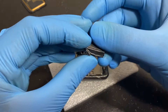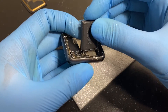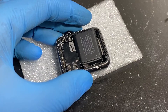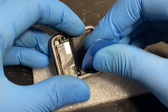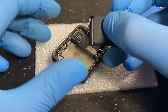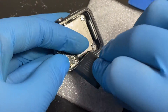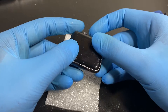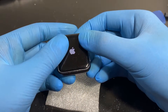Let's put the battery in — I'm not going to paste it right away because I need to test if the force touch sensor works first. The battery has some charge as I remember. It's a bit annoying to install with the camera in my face, but I'll fold it in. We've also put the display back to save time — let's power this thing on and see if the force touch sensor works before gluing everything in place.